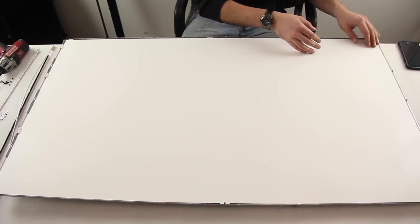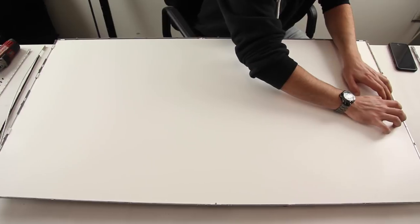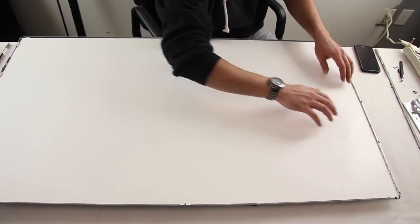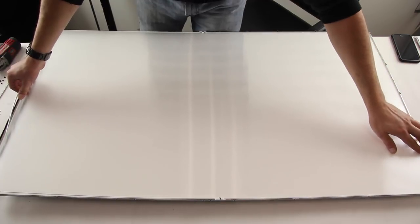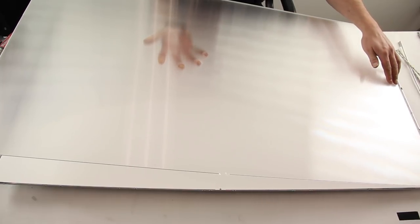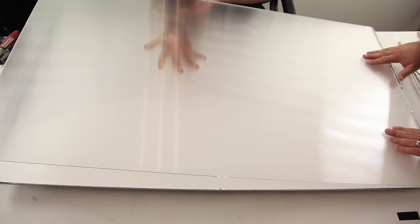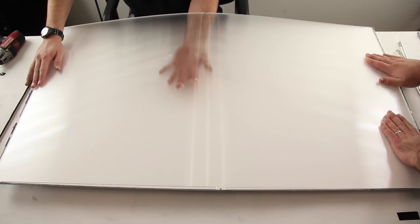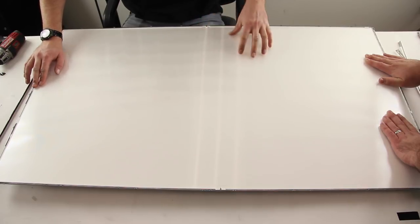Lay the reflector sheet back down on the chassis. You may need an extra set of hands for this part. Lay the diffuser panel down flat and then push it firmly up against the replacement LED light strip bar on one end, then lift the other end to make it bend a little and put that end down into position on the other end of the chassis. Doing it this way is necessary because the plastic piece and our replacement LED light strip bar is a little bit thicker than the original.